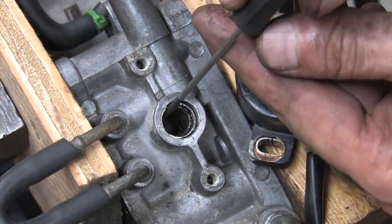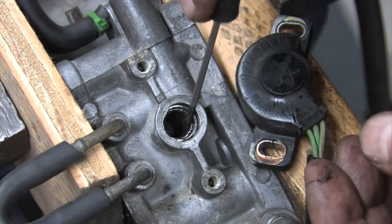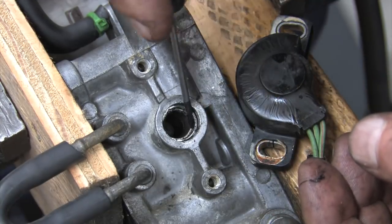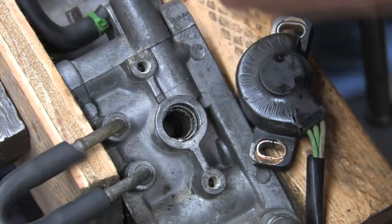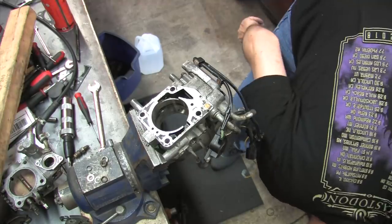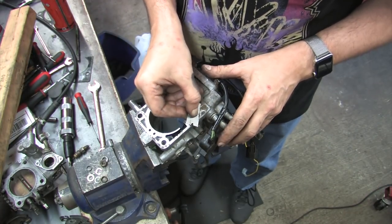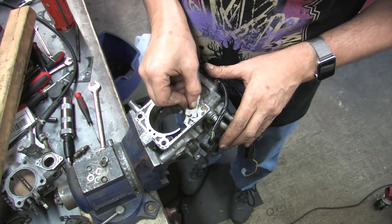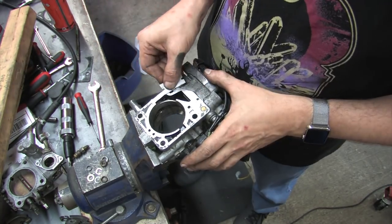Looking closer at the bore, you can see the small seal is recessed deeply below the rim of the throttle position sensor. You can see the broken down, dry rotted rubber junk from the seal in the bore. It's just evidence that the seals were done and not doing much of anything to keep the boost in. It's because of this discovery that I realize I don't have all the right seals, and so I take my frustration out on doing a little bit of cleaning.